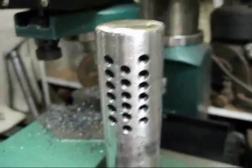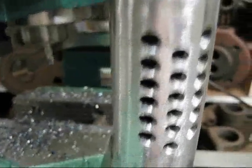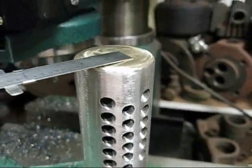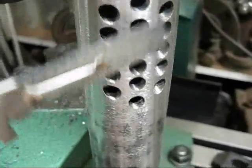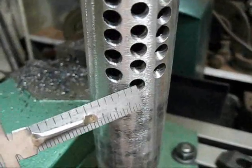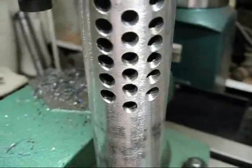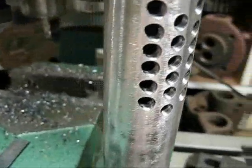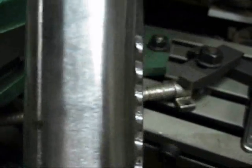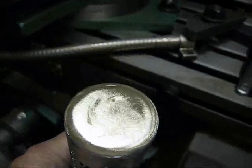This is the finished muffler I'm going to put on the engine — it's just a series of holes. I calculated in my head the amount of holes drilled in this pipe; it's blocked off at the top and drilled at an angle. I drew a circle of this diameter and then drew smaller circles inside it to see how many I needed to almost fill that area, because I like a little back pressure on a muffler system. I milled these holes in this piece of pipe, brazed the top on it — it'll put a little back pressure and change the sound.